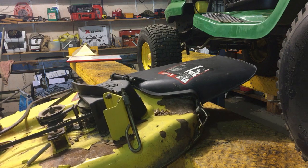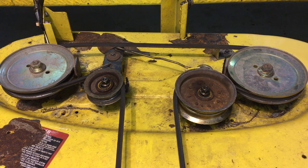You'll see that I've got the deck off of my riding lawn mower right now. It is so easy to take your mowing deck off — I have another video on my channel for that too. First thing you should really do is check for a sticker, a decal, right on top of your deck. It clearly shows you the correct routing of how that belt goes around those pulleys and back up to your engine pulley. If that decal is not there, then this tip is really gonna help you out.